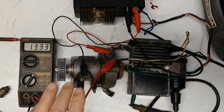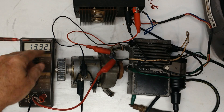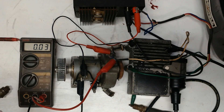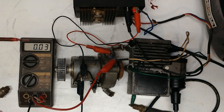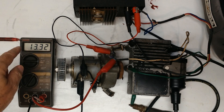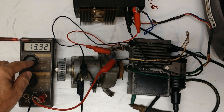If you've got an old distributor with an original pickup in it, don't be surprised if it doesn't go all the way to battery voltage nor all the way to zero. That's okay. My impression — and there's nothing carved in stone here — particularly with the MSD box, if it's somewhere about a volt or less when it's off and somewhere near the actual battery voltage to maybe a volt below that when it's on, that's okay.